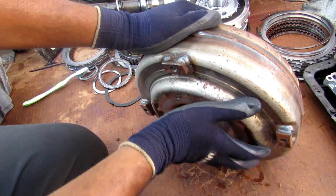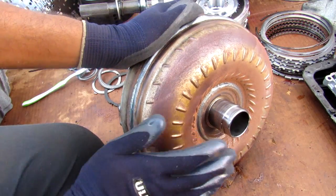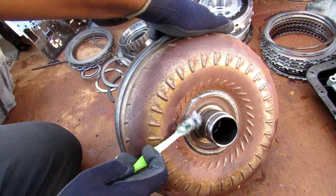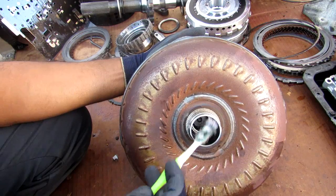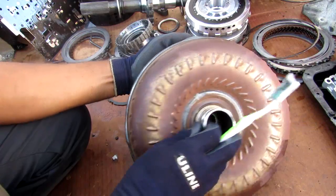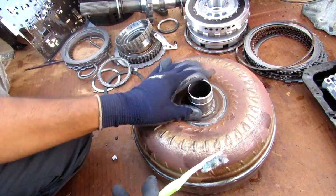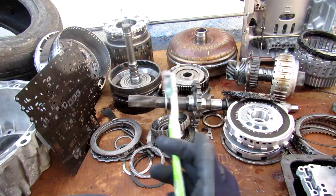One of the reasons why a lot of people don't like automatics is because of the torque converter — there's a lot of slip between the engine input and the output shaft going to the transmission, which takes away some power and fuel efficiency. However, the torque converter is also a big failure point on many modern transmissions. In summary, a torque converter can fail by: not having enough oil pressure; a worn lockup clutch inside that locks input and output together during cruising; or a failed one-way clutch inside that only allows the stator to rotate in one direction.